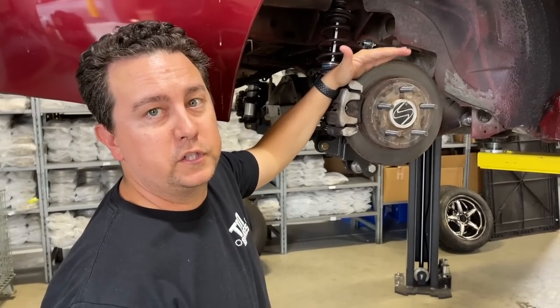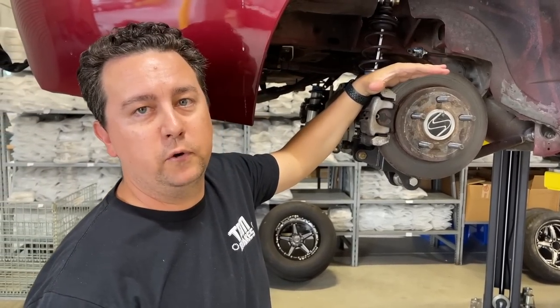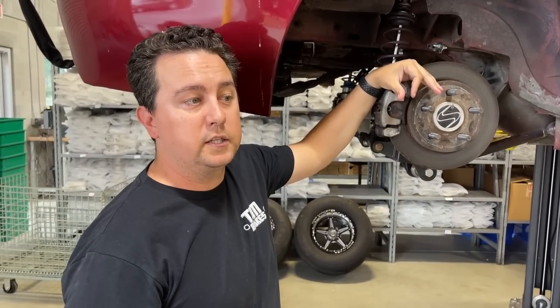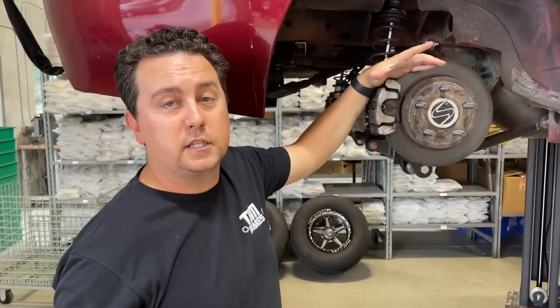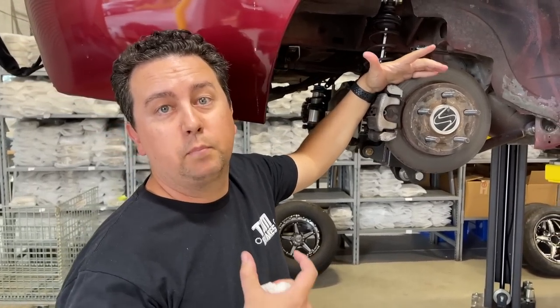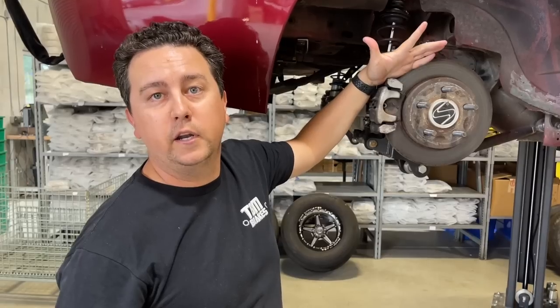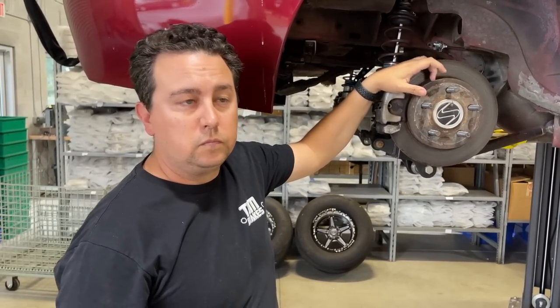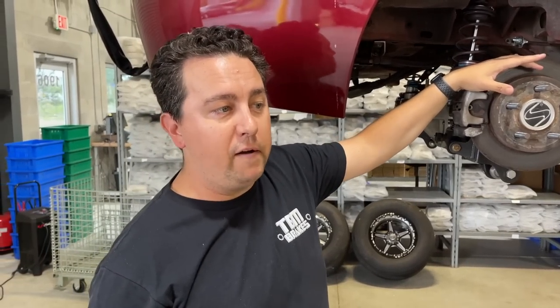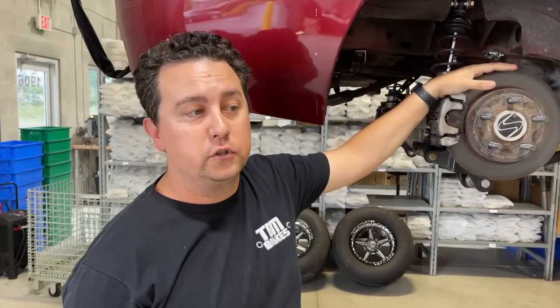There are a few different options of brake fluid: DOT 3, DOT 4, DOT 5, and DOT 5.1. DOT 5 is a silicone-based fluid and it's extremely popular in the hot rodding world because it won't eat up paint like the other types. The disadvantage is it causes the seals to swell, which causes the brakes to drag. So on a high performance unit where you're trying to alleviate any brake drag, you want to run DOT 3, DOT 4, or DOT 5.1 — not silicone-based. The TBM fluid we carry is a high-temp DOT 5.1 brake fluid and it's compatible with any DOT 3 or DOT 4, so you don't have to flush your entire system out; you can just add it and go.